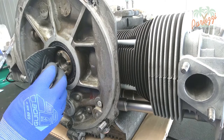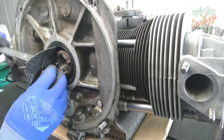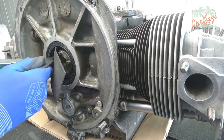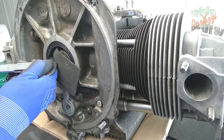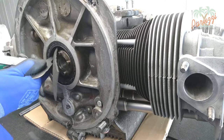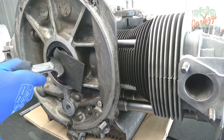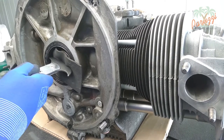The puller should grip the inside of the crank seal. Be careful not to damage the inner surface of the crankcase with the puller. Do this gently, with a firm pressure point on the crankshaft and the puller well positioned behind the seal — you can now start to apply force. The crank seal will slowly but surely come free.